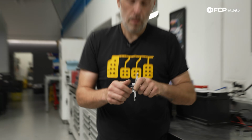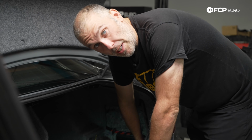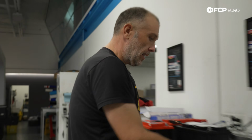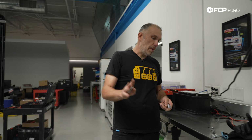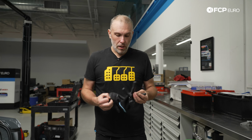And now, when we're gonna put the battery in, we'll be able to bring this down back and be able to thread it in and get it started with our hands from up top as opposed to forcing it. Funny enough, the 1 Series uses a longer hold down screw, whereas the E90s use that really short hold down screw. I'm sure on the 1 Series space is even tighter, but there's no reason we should make this any more difficult than it needs to be.